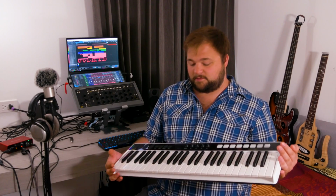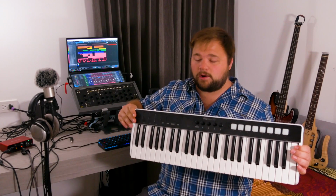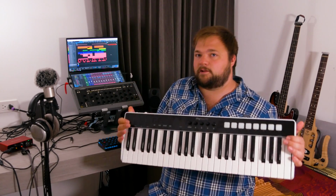This was really, really off-putting to me when I very first pulled everything out of the box. It was something that I had read about briefly, reading other people's reviews, but didn't really think too much of it at the time until I got it and really started to think about it. First of all, unless you're in a situation like I've got my computer right here, right next to where I have the keyboard, that's totally fine and it happens to work for me. If you need to put this more than a foot or two away from your computer, you're gonna have to buy a USB extension cable, and a very high quality one, because it carries all of the power for the phantom power for the mic input and for the audio interface that's built in, as well as for the keyboard, the encoders and everything.